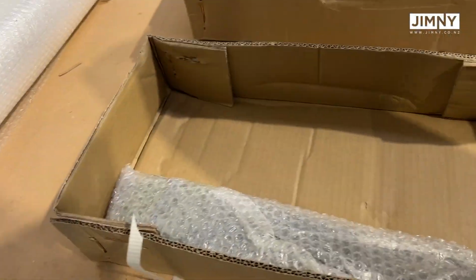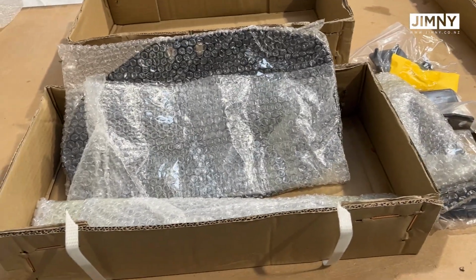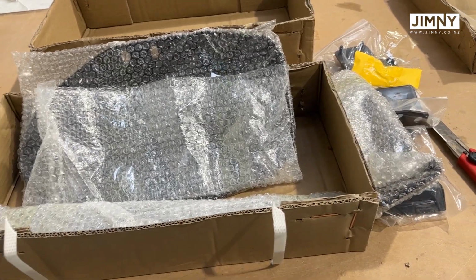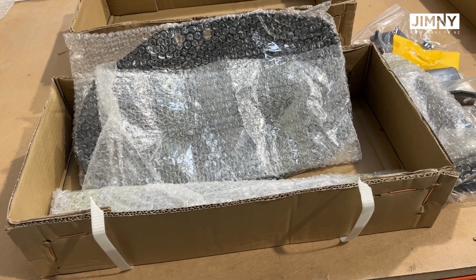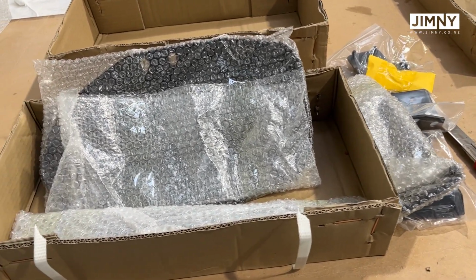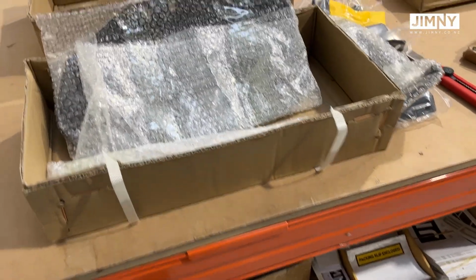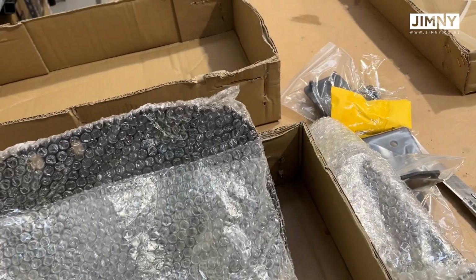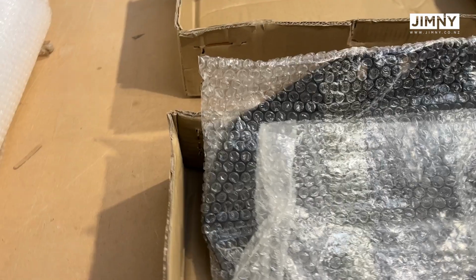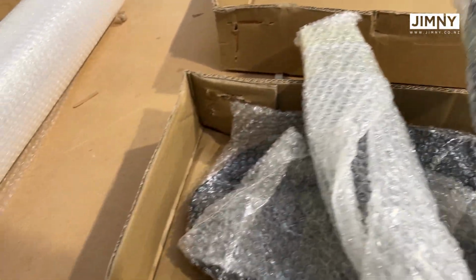Even better, our transfer case guards come with steel mounts to mount the transfer case. So originally, like a lot of vehicles nowadays, they come with mounts for mounting the transfer case that are made of cast alloy. That is a fairly weak solution, light but fairly weak. A good rock strike and the transfer case mount will break, and that can really wreck the day.